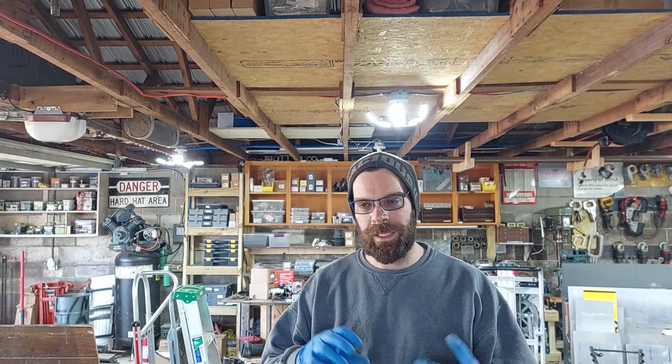I should be able to do it, but I got real frustrated with one of the bolts on the engine mount. Passenger side engine mount just fought coming out. For a minute there, I thought maybe somebody had welded the washer to the frame plates. It was just rubber. And I'm thinking what happened is the frame mount, the engine mount, the isolator part, actually collapsed in and was putting that bolt in a bind. And that's why it wouldn't come out. The driver's side came out simple, no big deal.